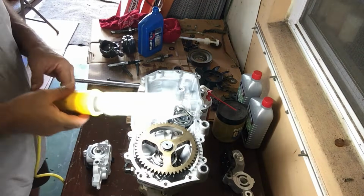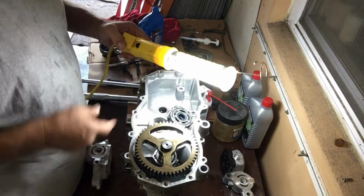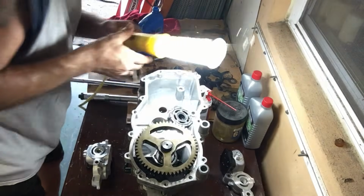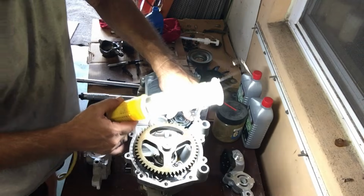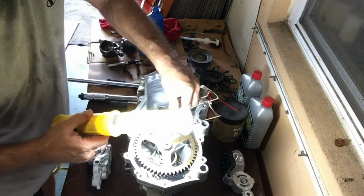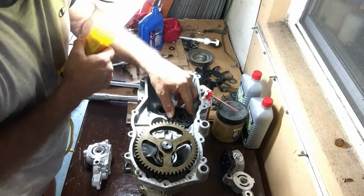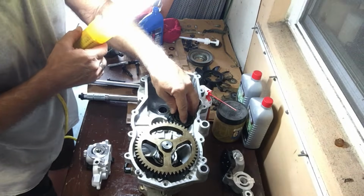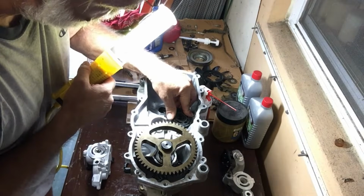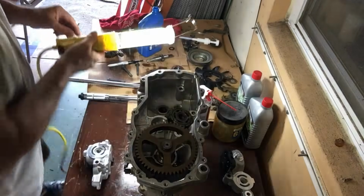All right, so it took me about 6 tries, actually exactly 6 tries, to get the motor pump back in and seated on that ball bearing properly. Just push down on it, and make sure that the pistons are moving freely on the springs. Another little piece of that, see this little gap over here, a piston can often fall in there, and then it feels like you have it seated properly, so just make sure you don't have a piston sitting in there. Otherwise that's going to ruin your transaxle if you put it together that way.